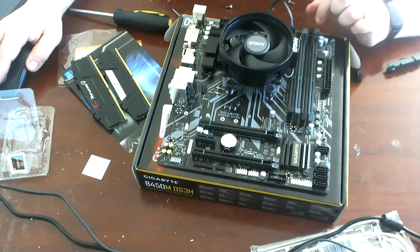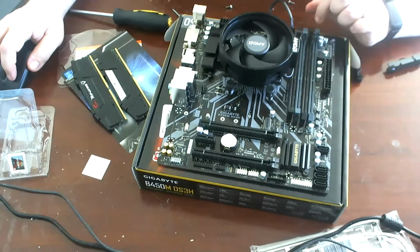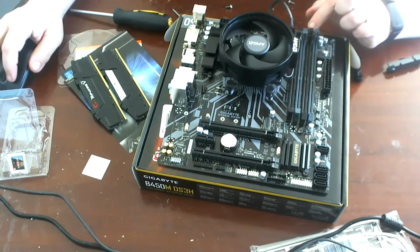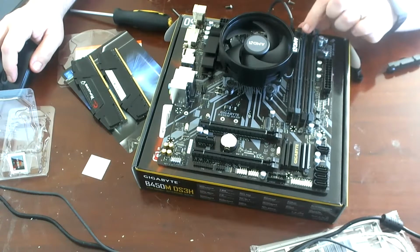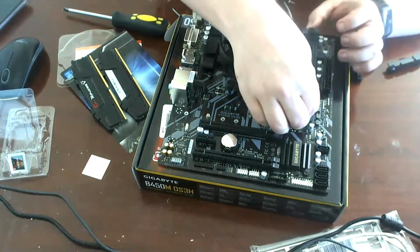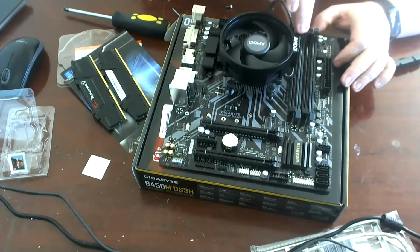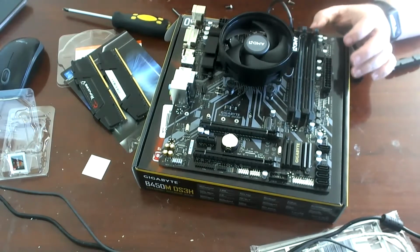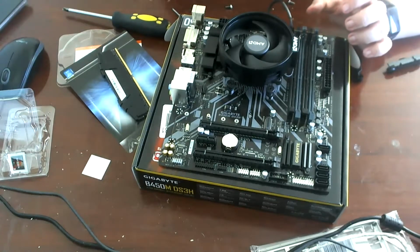Check the Gigabyte manual. And it says indeed that we want 1 and 2. So yeah, because 1 and 3 are both on channel B. So we want 1 and 2. So we want the two that are the same color. So we're going to use the two gray ones, which is actually a little bit better than I was hoping, or better than I thought a minute ago when I saw that I'm going to put two of them close together and none of them far apart.